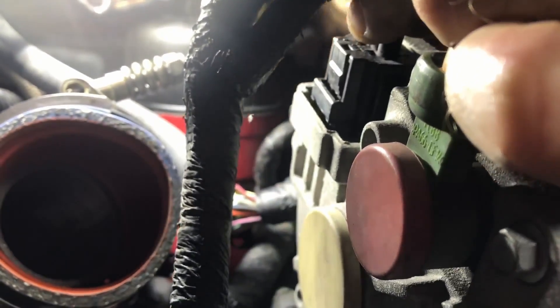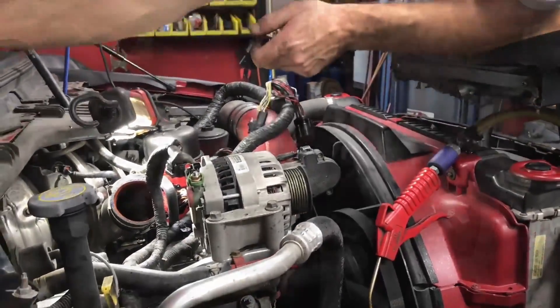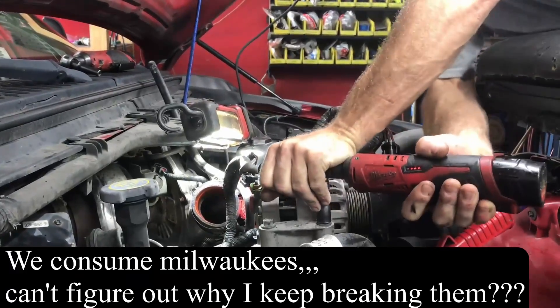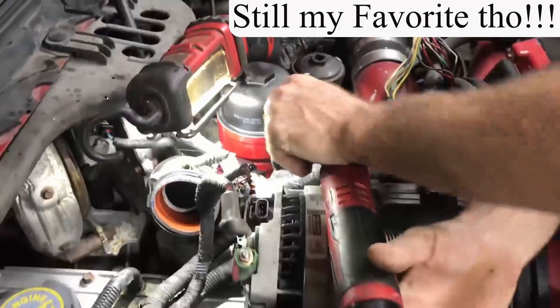Take a 10 and a 13 — you will break that plastic, so watch that little tab. Look at all these lights in the way. Do you feel that click? You hear it? Then it comes right out. Go ahead and break the 13s loose first.